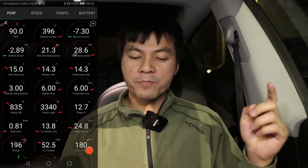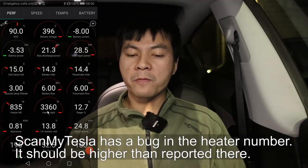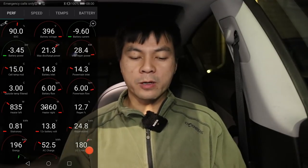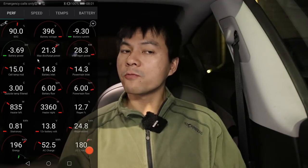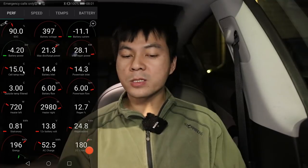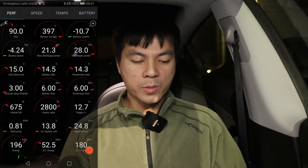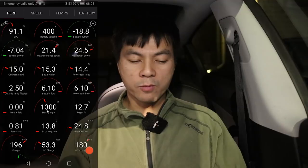One interesting thing is that the heater fires up at around a little over 4 kilowatt. It goes high in the beginning and then settles slightly lower as it tries to heat up the car fairly fast. But notice that the afterburners are not running. The car actually chooses to prioritize charging up instead. Because I set the charge limit to 95%, it probably figures out that 15 degrees Celsius in the pack is still okay, so heating the battery isn't necessary — it's more important to reach the desired charging limit.